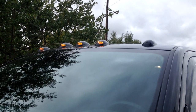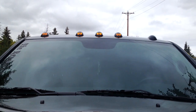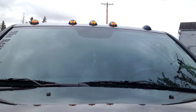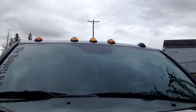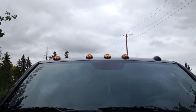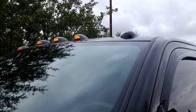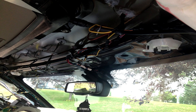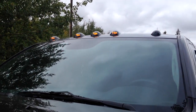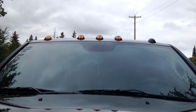Lastly, back to those cab lights. I've got new ones on the way, and the reason is — for the third time now a cab light has gone out on me. I've done a lot of wiring in my day; they're soldered, they're well done, it was working for the longest time and it just crapped out. Basically moisture is getting to these. From all the reading I've been doing online, there are a lot of complaints with the Recon cab lights — they just stop working. Some people get three months, some six months, some a year. I got two months and three lights are now gone. These are not ones you can just pop open from the top and replace — I have to drop the headliner every time. I'm sick of it, so these are going in the trash. I've opted to go with the Pacers — a lot of people are having better luck with those, and I've heard of guys who had problems with the Recons, switched to Pacer, and haven't had a problem since.